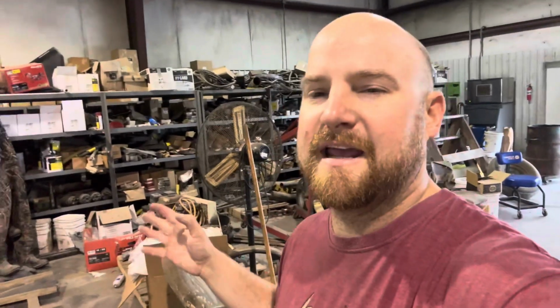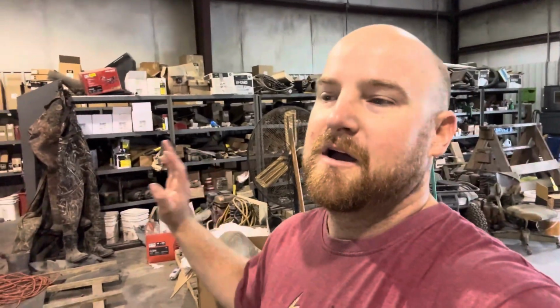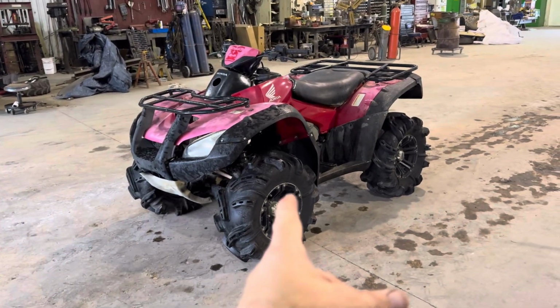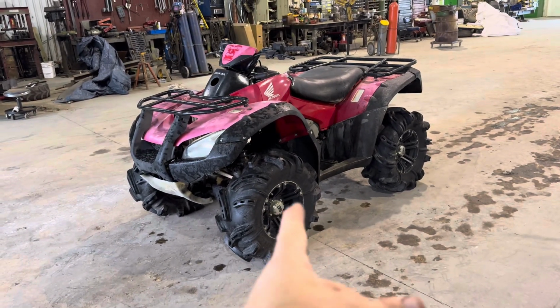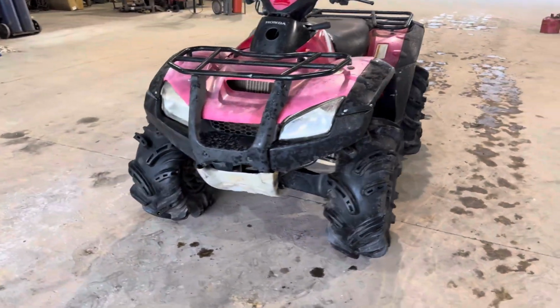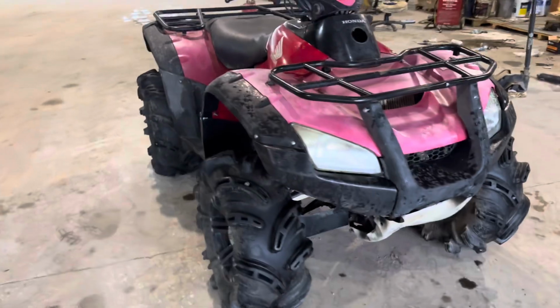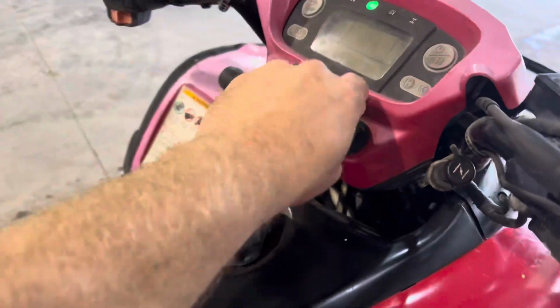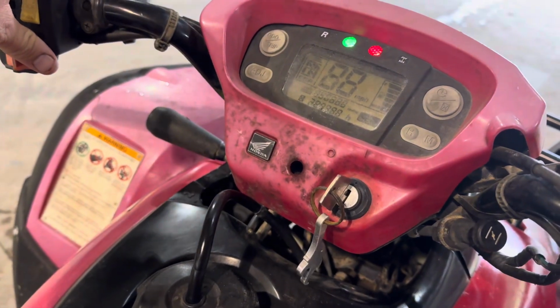And we got the top end on. We got all the new chain. I had to take the whole front end off, the torque converter, all that, which is still weird to me that it has a torque converter instead of clutches. And the thing that I'm surprising y'all with is the guy did not give me a 650 jug and piston. He gave me a 680 jug and piston. So I did a lot of homework, and apparently you can just put a 680 top end on these and they'll run. And I've been driving around, and so far it seems to work.